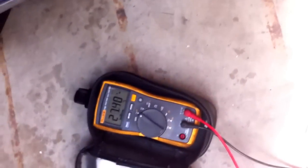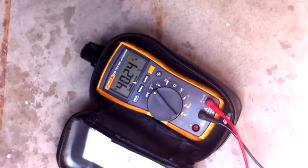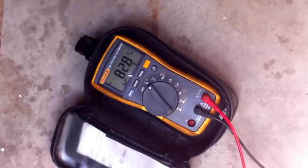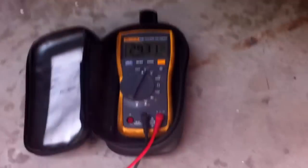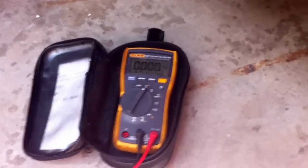Some people say when you rev the bike up to excess of 5000 rpm, I get 83 volts off all three phases. I hope that's a little help to you to test your bike's generator. Sorry about the noise, I hope that helps you test your bike's generator.